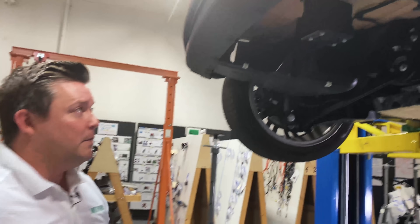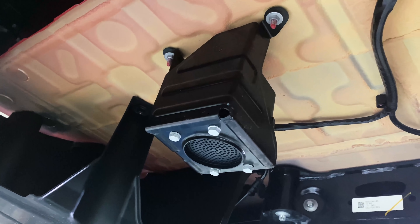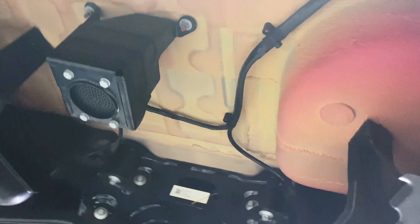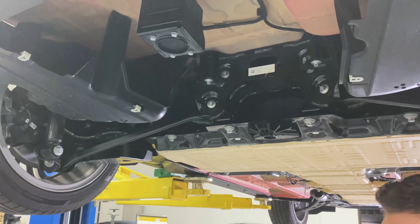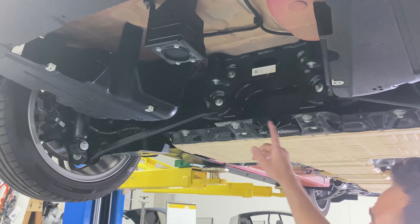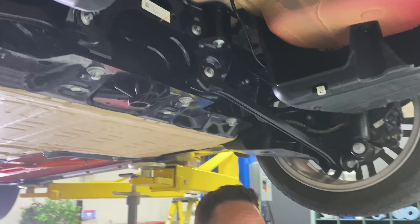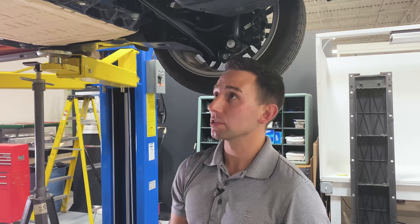There's also no spare tire. Here's your noise maker mounted right in the center where you'd see your spare tire. There is room for a spare, maybe. When you're talking about putting hard-mounted structure here — because the battery pack is hard mounted and the cradle is hard mounted — why not join those two structures together so they complement each other versus having redundant attachment points and redundant fasteners? That's not a bad execution.